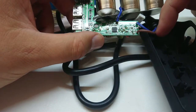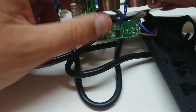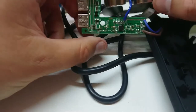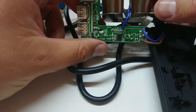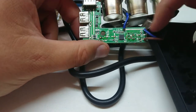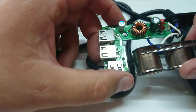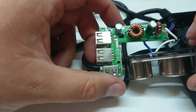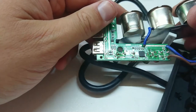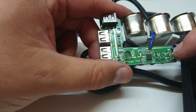Our hot wire goes into here — so that's our poly fuse to our hot wire; makes total sense. In that case I'll probably run a bit more solder along there just to bulk that up, although if it is being used as a shunt that's probably a bad idea. I don't see any wiring coming off either side so I think the shunt idea — no, they just used a piece of track. There is a little capacitor across it though.